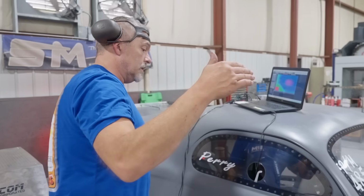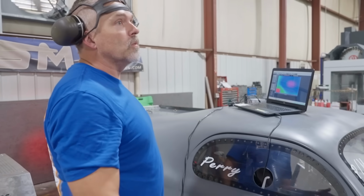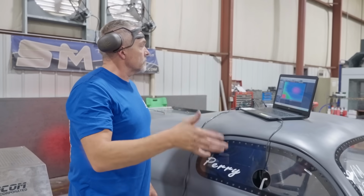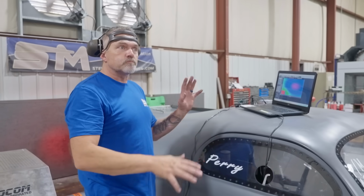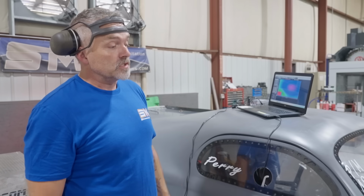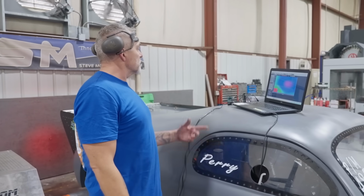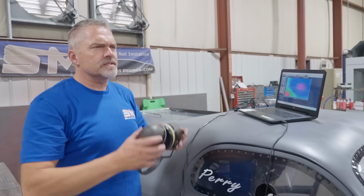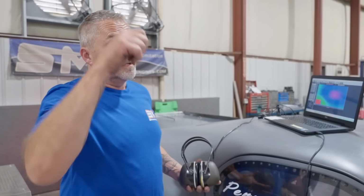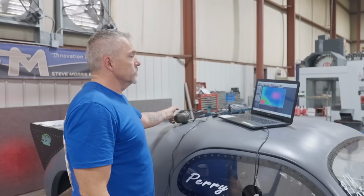All right, and I leaned up the idle just a little bit more. You heard it pick up a little bit more, got a little bit cleaner. It looks like it's idling around 5.5, right around that range, which is pretty normal. EGTs are actually pretty hot right there, in the 700 range, which is pretty hot and clean, but it still revs up. So that's cool. My general rules are here.